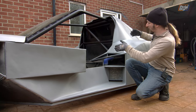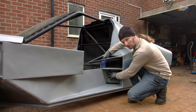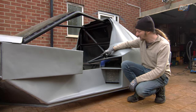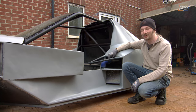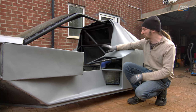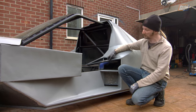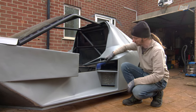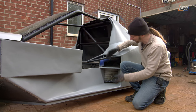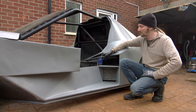Moving back along the car to the back of the passenger cell, you can start seeing the running gear — the beating heart of the car. There's blue silicone pipe to get boost out of our intercooler, with another one on the other side. This is basically the same setup as the Audi TT we pulled the 20V turbo engine from, except we've swapped in a pair of intercoolers from a crashed A6, because the boost inlets and outlets are perfect mirror images of each other on both sides of the car. To feed them cool air, we put ducts down the sides of the car, and we've also added a third intercooler stolen from a Land Rover Freelander at the rear.